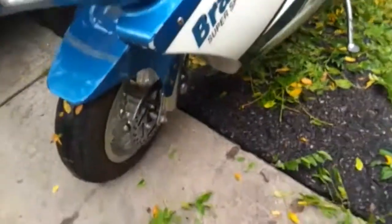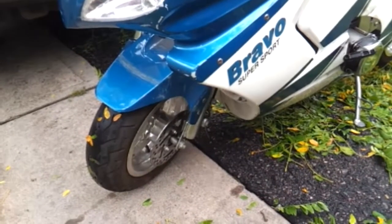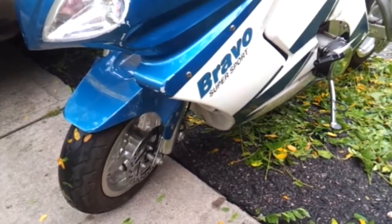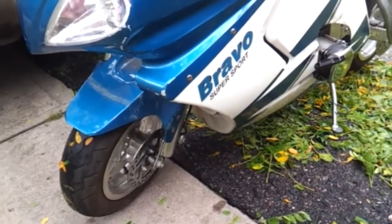But it's running now. The problem was a bad spark plug and some flooding in the engine, so I had to just get it unflooded and clean out the air filter, which got filled with oil and gas. It just needed a little bit of cleaning, so I had to take it apart for a minute.